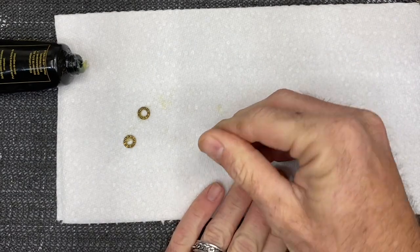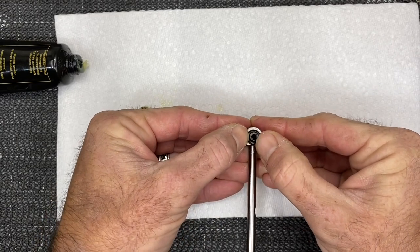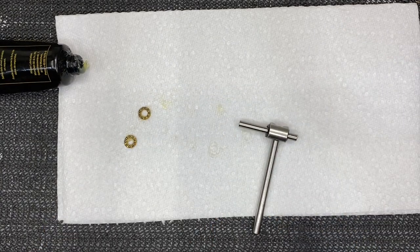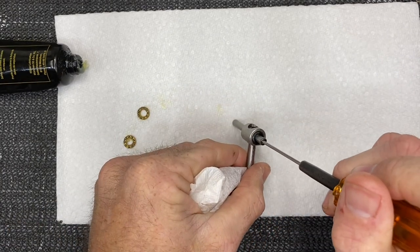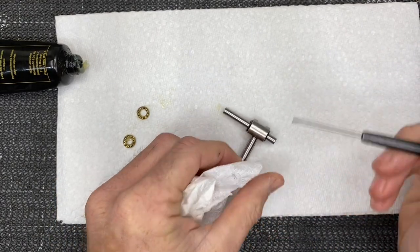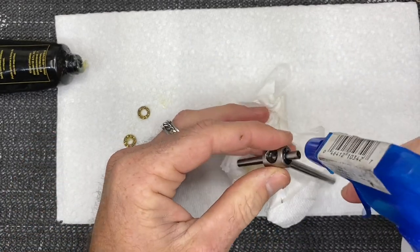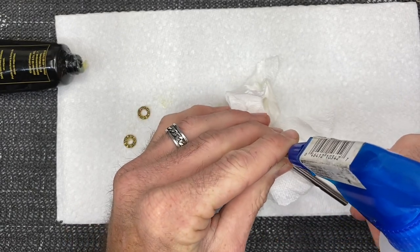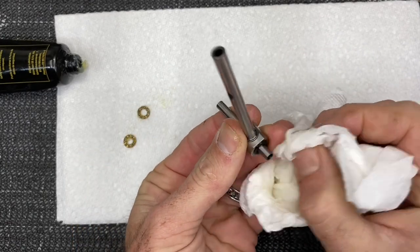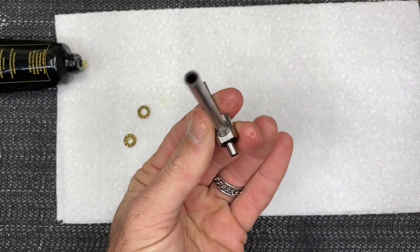Insert it in here, flip it over — you might have to use your nails. If you see a little bit of grease there, that's okay. Come back with a driver and a little bit of rubbing alcohol on a paper towel and carefully get that grease out of the shaft. If you feel like you've got too much grease, have a paper towel ready and blow rubbing alcohol through the shaft from the clean side — that ensures a clean, secure location for loctite to adhere to.